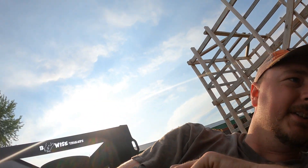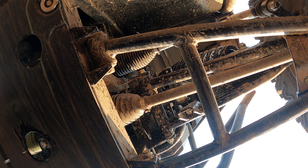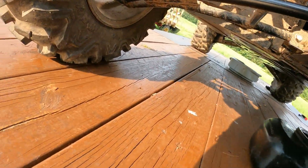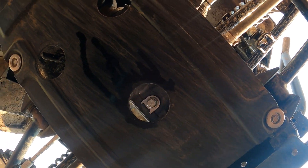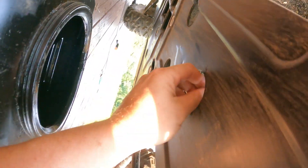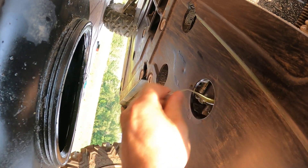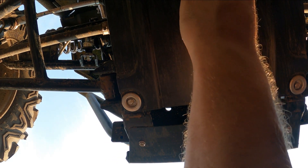I've got a separate drain pan now. The front differential is going to be a 14mm drain plug, just like the back. I'm going to give this a little spray, just like I did with the rear — this one's a bit cleaner. There's the fill port here — that's an inch and a sixteenth. I'll crack this one loose. The front looks to be drained out well, just getting an occasional drip. Enough to move the pan out of the way and put the plug back in.